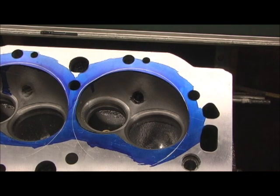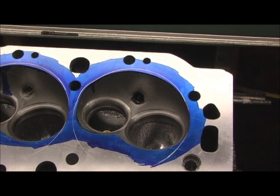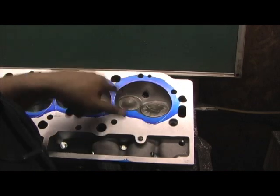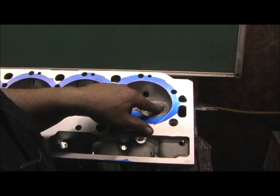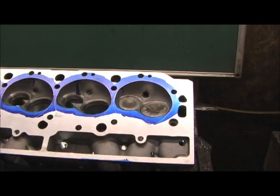So now I'm going to go ahead and pick my valves out and lay them in — the ones I'm going to use to cover the seats while I butcher this thing. A 2250 and a 1880, and 1130 for my cutaway. Since I'm going to a much larger valve diameter, that's going to allow me ample cutting room to go in there and trim.